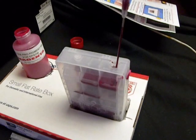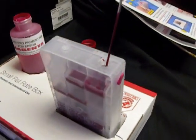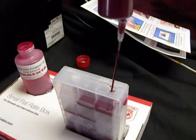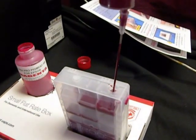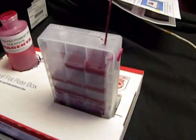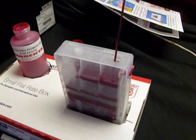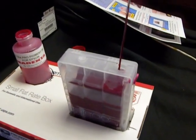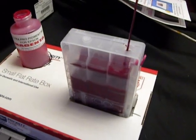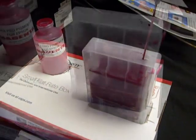After you fill it, put the big plug back in, and take the little air plug out that's on the side. You won't use the air plug unless you're going to store the cartridge — you probably won't use it anymore. This cartridge is going to hold approximately 110 milliliters of ink. That's a lot of ink. And with the new chip, they're now very stable and can be mixed with Epson cartridges.